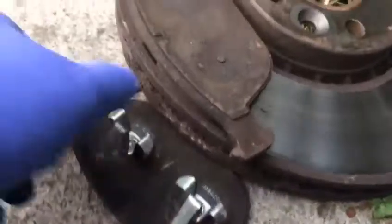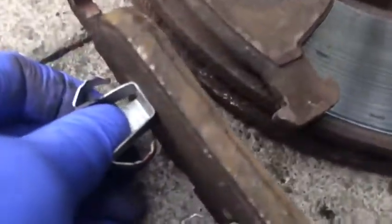So remember, if you've got uneven wear on the disc or the pads, you've got a problem with the caliper. Because as you can see, look — the thickness is gone on the inner and outer. So just inspect this one. Thanks for watching, bye.